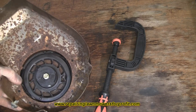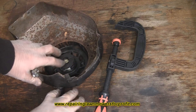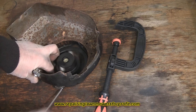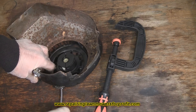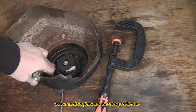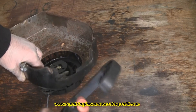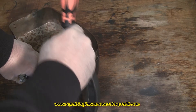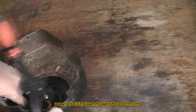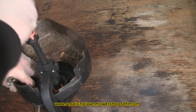The safe way to replace the starter rope is to pull the cord out and using your fingers just stop the recoil from turning against the spring. Hold it and pull it out as far as you can, then pop your clamp on just like that — pop it over the top. It's quite fiddly to do under tension, so just tighten it up.